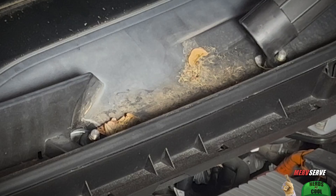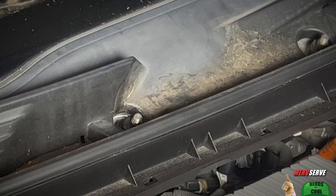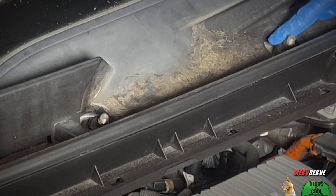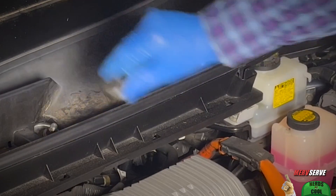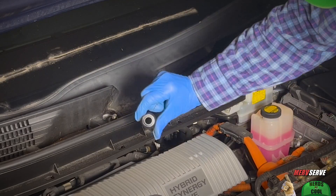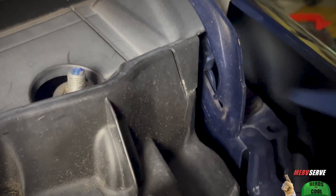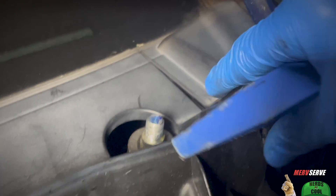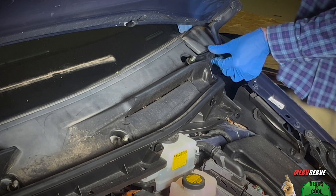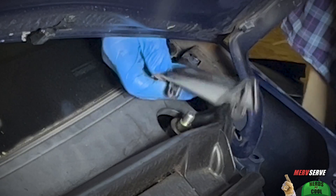Make sure you put that word organic all over the screen because we're dealing with Prius owners, you know? And let's make believe I didn't just suck one of these into the shop vac, but instead we consciously removed them both like this. Now, over here you've got an extra trim piece you can pry out. And I always pry plastic with plastic — you could tell somebody pried this one with a screwdriver — but there's one of these on each side you've got to pull out. I'm just illustrating with the driver's side.